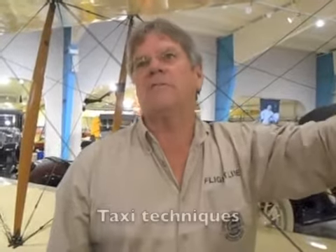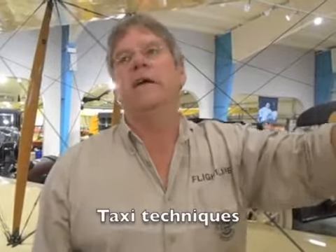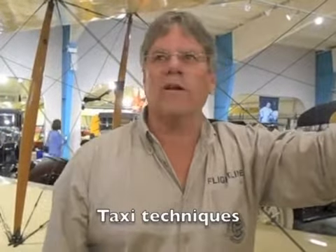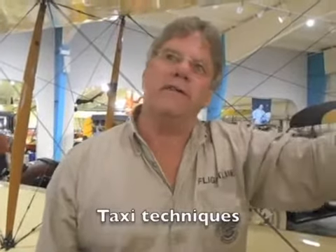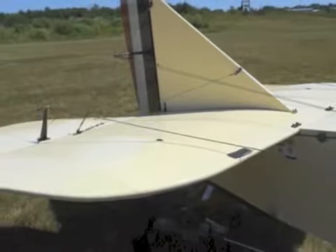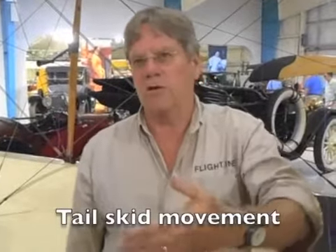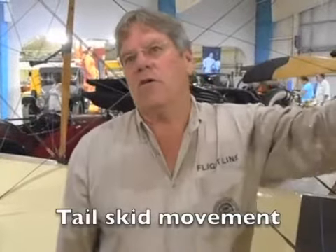At other times I just stopped, and from a standing start you can goose it, give it some power, take the weight off the tail, and it'll come around by itself and you can start moving again. This airplane's tail skid is not fixed in a horizontal position — it will go side to side — so it's easy to oversteer a little bit, and that may have had something to do with it, but it was the wind just telling the airplane what to do.